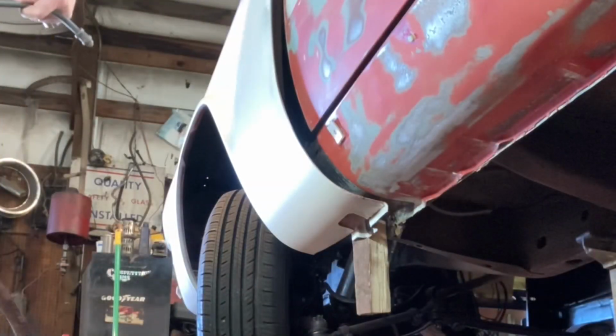That area is really bad about rotting out. My white Challenger, that was pretty much destroyed, and I had to totally rebuild it. But yeah, if you ever buy a new car or want to check yours out, pop those couple bolts out and look through there. You can even see this has still got some original seam sealer on it that's starting to peel and crack. Pretty funky in there. Let me see what comes out.